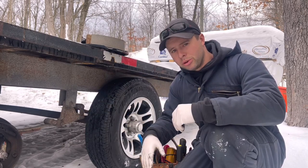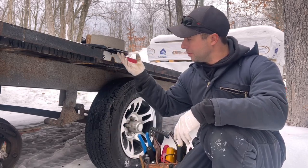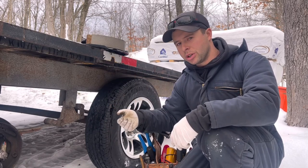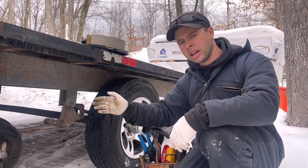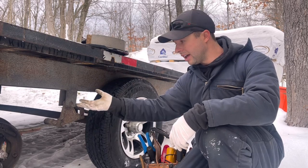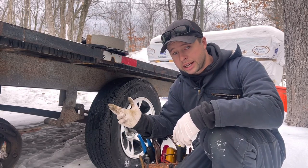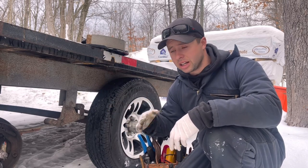So if you've got to tear into your trailer brake job, now you know how they work and how you can get an assembly for really cheap and just bolt it in. I'm all for old school mechanics and replacing only what parts need it, but for $56 how can you go wrong — and you know everything's new then. It seems on old drum brakes you'd replace one part and then a spring would break the next year. Everything's new here and we're good to go. It's four bolts and two wiring connectors and you're done. I'll go up into the harness — whoever made this trailer might have a bullet connector or it's probably heat shrink butt connectors, so we'll just cut it, heat shrink it, and we're done.